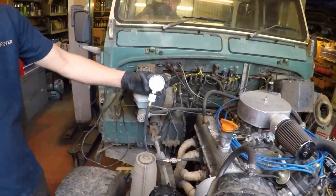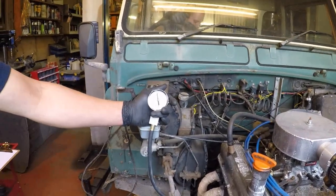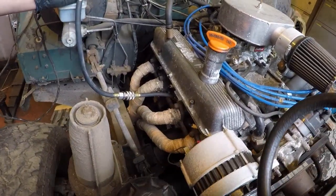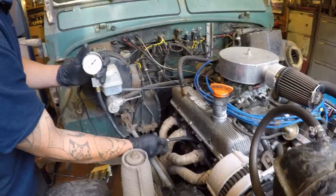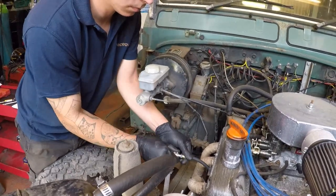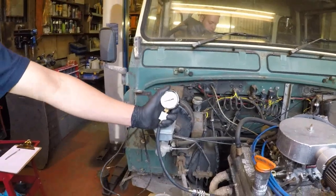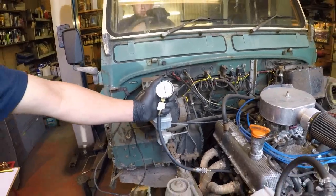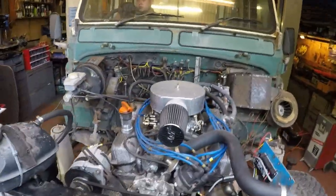Right, here we go — next cylinder, this is cylinder four. The first test on that is showing 125 psi, which is a bit lower. We'll check our connections to make sure we're all plumbed in correctly on the compression tester, because that is obviously significantly lower than the last one. We'll do our second test, and if that reads the same we'll move on to the next cylinder; if it's different, we'll repeat until we get two matching readings. Again, 125 — so that cylinder has a bit of low compression. It's not too bad, but it's a bit more than I'd like. We'll move along and see what the rest read.